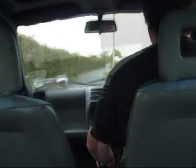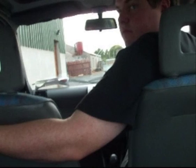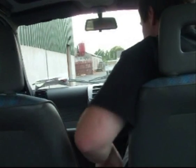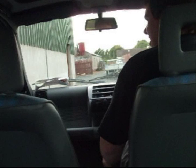Seems quite good. Right. That's pretty good. The exhaust guard seems to be rattling a little bit. I don't think that's a big job. But apart from that, everything is fine. Of course, there is a little bit of a whine out of the oil pump as well, but I'm not too worried about that for the moment. If it gets worse, I'll probably take off the sump and have a look.